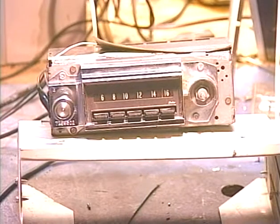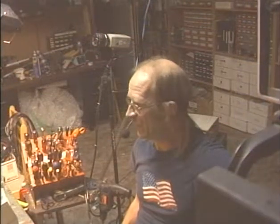This is a good option for the customer who does not want to tear up the radio and make any irreversible changes. This little FMC module can be removed at any time with only one wiring change to put it completely back to its original state. So with that stated, that was an FMC conversion on a mono 1967 Chevy Impala radio.